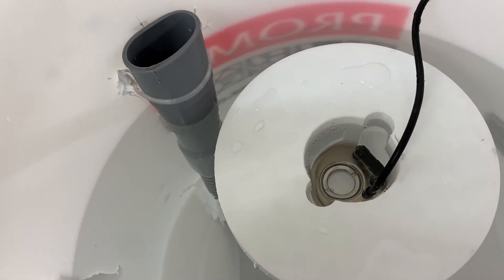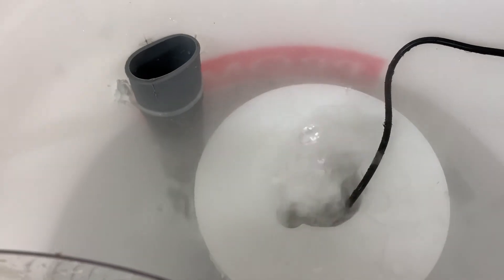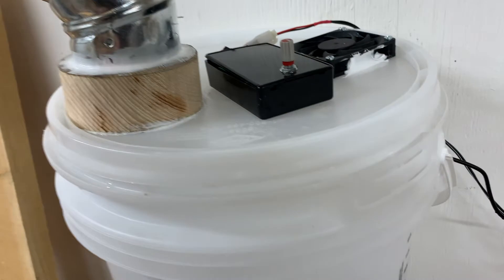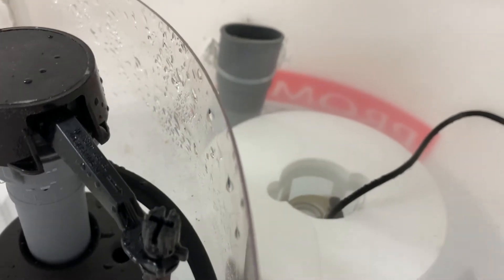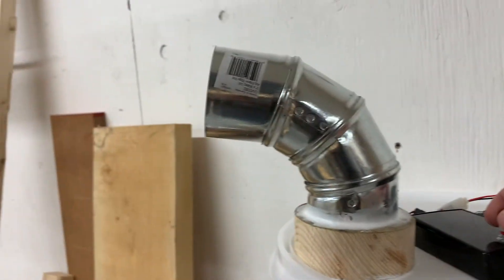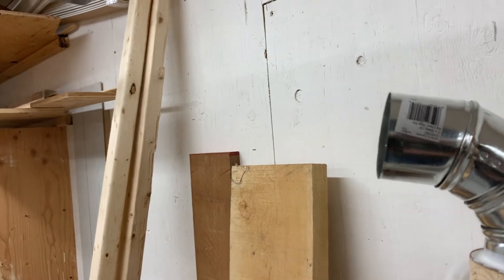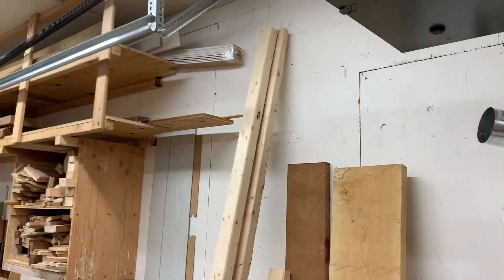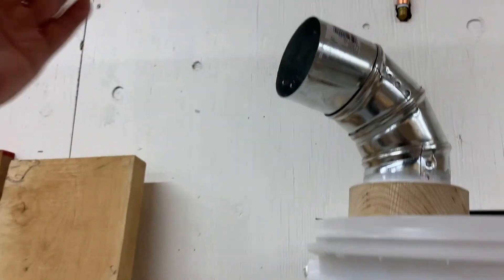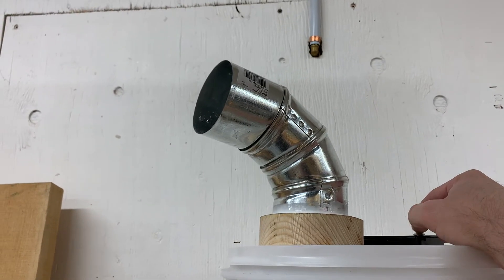The water is back to normal level — about 10 liters. If it ever falls to around 9 or 9.5 liters the valve auto-fills. The mist maker is in there now, floating at the right depth. When I plug it in, you can see it vibrating the ceramic disc and making mist. With the lid back on and the fan running, mist goes out through the chimney — you can see it coming out. I can adjust the output rate by adjusting the fan speed.